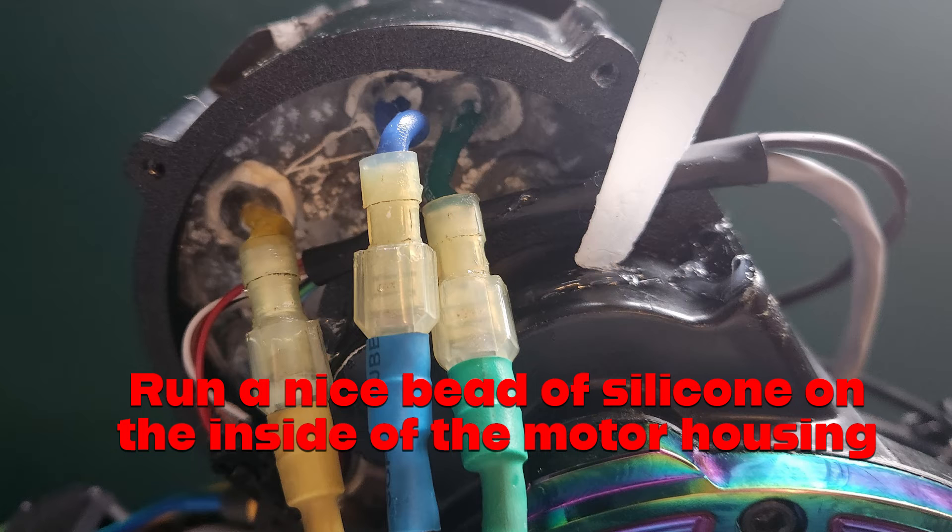What I like to do as well with the cover is seal up the gap where it meets the motor around the edges. This is because I ride in the snow and what I find is you tend to get snow build up in and around the motor, then it melts and there's naturally a little bit less compression on the inside of the gasket. So I do like to take the extra precaution here to stop moisture sitting in this gap and potentially working its way inside.